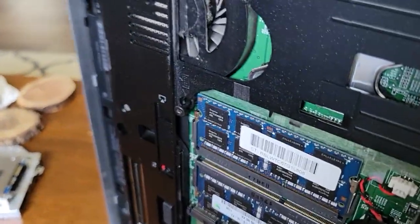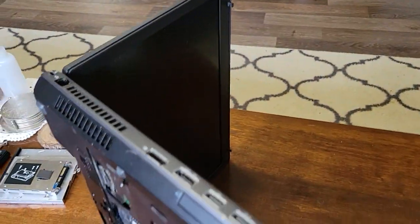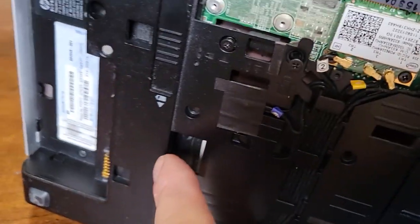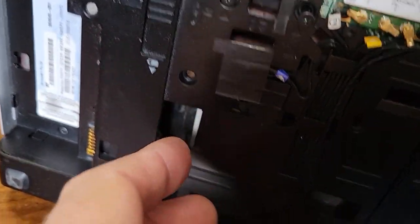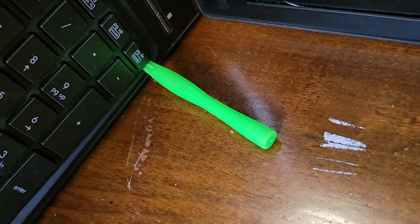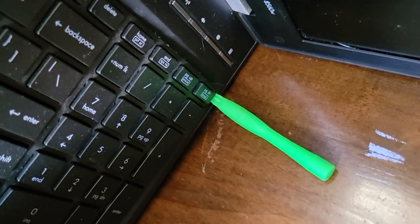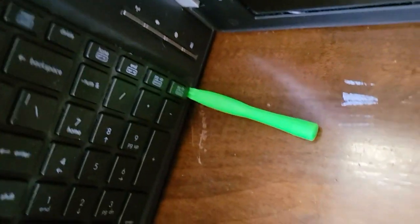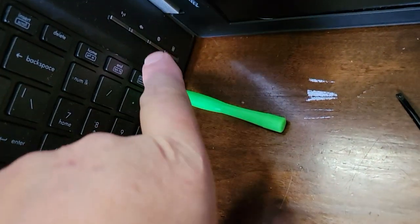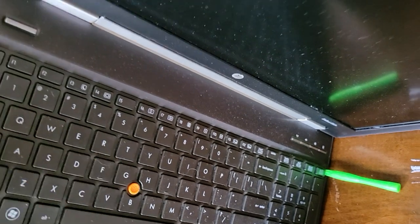To take out the keyboard, set your laptop up on its side. There's a hole right here you can push on — you'll be pushing on the back of the keyboard. You can also at the same time use a little pry tool. See, I'll push on the keyboard with my finger — see how it's moving — that'll give you a little space to get your tool in there, and then you can pry up on the keyboard and loosen it all along the edge.